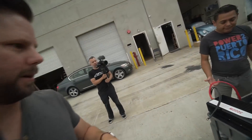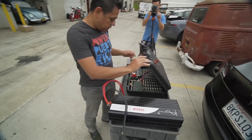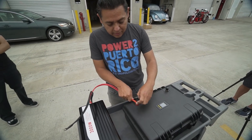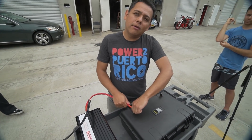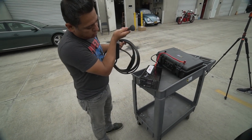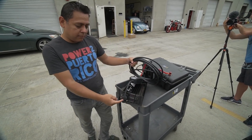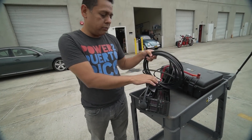Let me show you. We'll have to plug this in — let me turn it off first. It's got a switch here. Safety first. These inverters have large capacitors inside, so when you plug in live it'll arc-spark. So you basically plug it in here, and even though it's set up for 110 it will handle 240 or 220 no problem. Then we turn the switch.